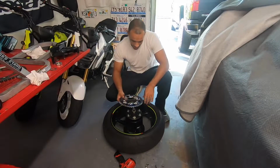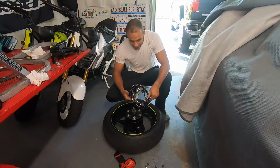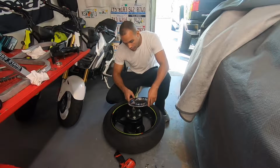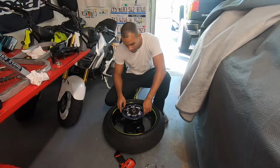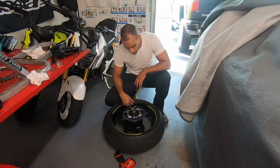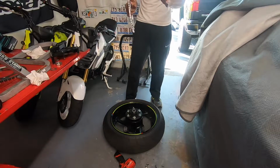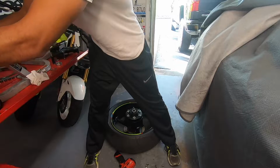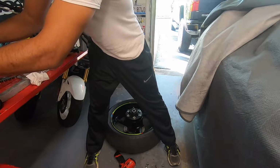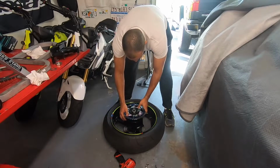Speedbug fans, like I said, we're back here on the motorcycle content. Went with the blue anodized aluminum Vortex sprockets. I was going to go steel for longevity, but I don't ride this bike 24/7, so the aluminum will do just fine. Before I install, I always check my pitch to make sure that it actually lines up with my chain. God forbid that they ship the wrong one, but we are all good.